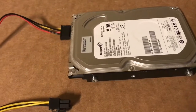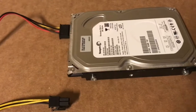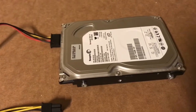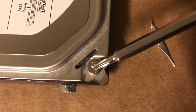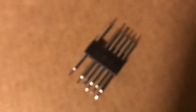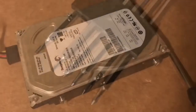First, I'm going to show you how to open up the hard drive. You can check to see how many platters it's got — the more platters, the heavier the spinning wheel of the hard drive, and the better it's going to be as a gyroscope. These types of drives have star-shaped screws, so you can buy mini screwdriver sets that come in a variety of different shapes and sizes — just look for one that has the star-shaped screwdriver.